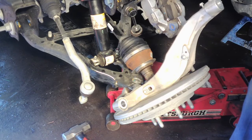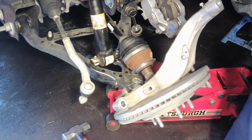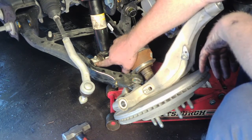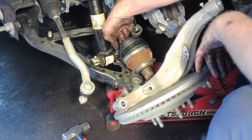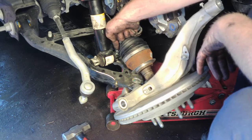Alright, so I went ahead and slid the strut up top, and I started the nuts that come with the kit. They're the bigger nylon nuts and washers. So I got it secured up the top, and then I got the bottom started. And the instructions say put the factory clip back in the front on the front side and leave it out on the back side, and they give you a new bolt, 2 washers, and nut for the back side.